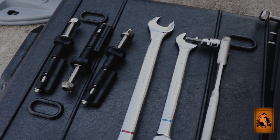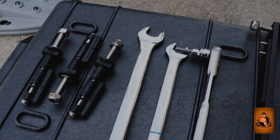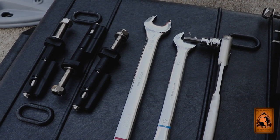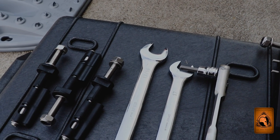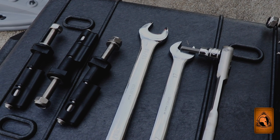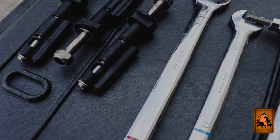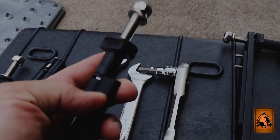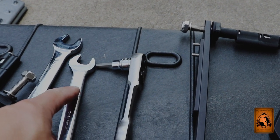I'll share a couple things I've noticed already with mounting these brackets for the max tracks. My idea is to mount them as low as possible on the side — they'll stick off the side, but I definitely need to consider the rear door opening on the FJ. The threads on the max tracks pins are very long, just to give versatility depending on what you're mounting them to. You also have the ability to take one max tracks off or mount one, since there are two different tabs for different thicknesses.